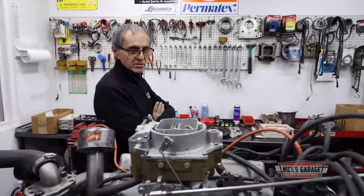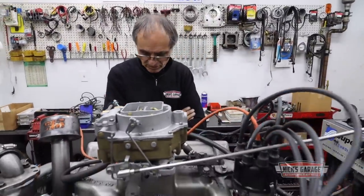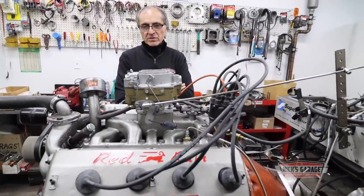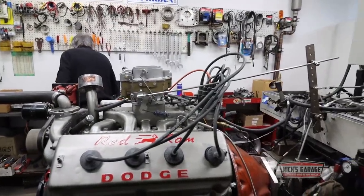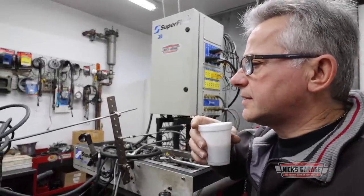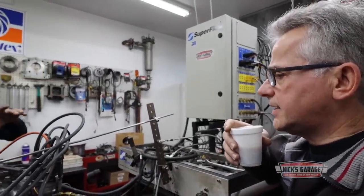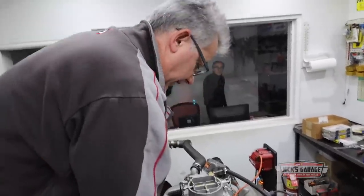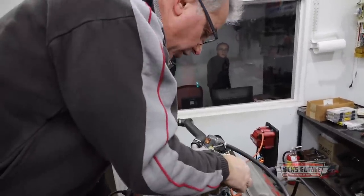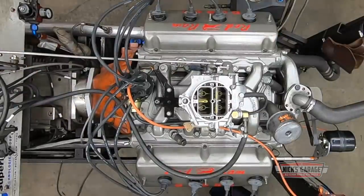That's strange. What happened? Wait, we put a bigger number, and it went your secondary thing. Activate the mechanism. Tell me if it's full throttle. Okay, watch this. Okay, there you go. No, your secondaries in the back are closed. Okay, then we got an issue with the linkage on the carburetor. I must have put something wrong. Go full throttle.